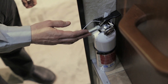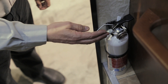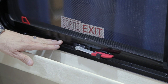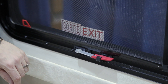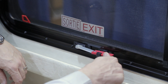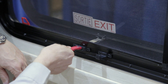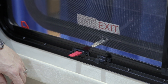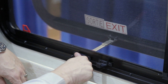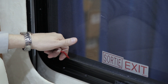Your vehicle is equipped with a fire extinguisher for your safety, located just inside the main entrance door and close to your kitchen end panel, accessible from inside and outside your vehicle. Your vehicle is equipped with several emergency escapes. One emergency escape is by either rear window — push the red handle in towards the inside of the vehicle, snap it out of position, and slide your window open. For emergency, push it wide open and pull your red pull tab to remove the screen from the window.